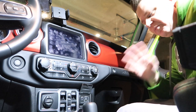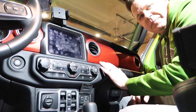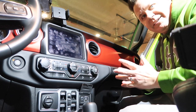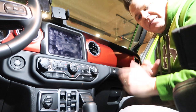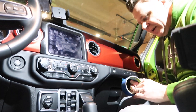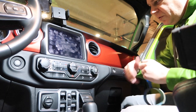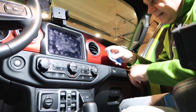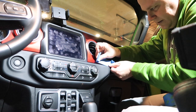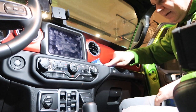I'm going to hop over to the passenger seat and we'll get started. I've got a spotlight going so you can see the dash really well. Basically what we're going to do is remove this HVAC cluster panel — it's real simple. The first time you do it, it is a little nerve-racking because it's going to sound like you're breaking it, but it's just a bunch of plastic clips behind here holding the whole panel on. First, grab your blue painter's tape and put some along this edge so it doesn't damage anything when you pry to get this to pop out.